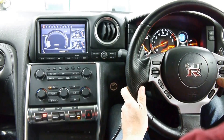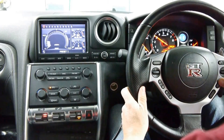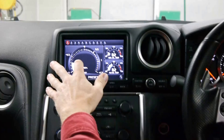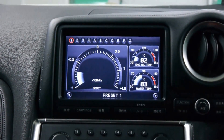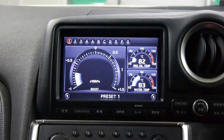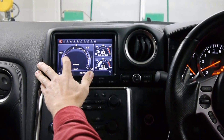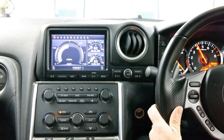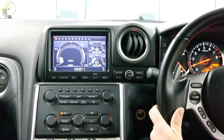What we've done is configured it for mode 3. We've got the same launch RPM but in mode 3 the target is minus 0.3 bar. So we should have the same launch RPM and we will see that the manifold pressure will have increased by 0.2 bar. Ready for launch.